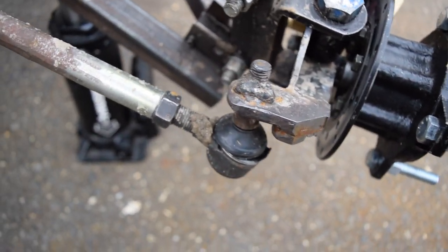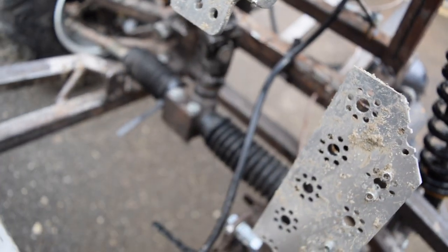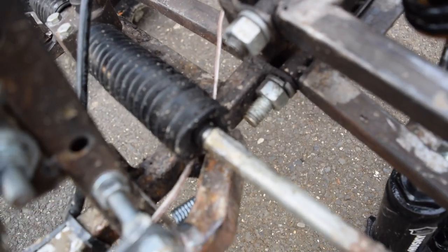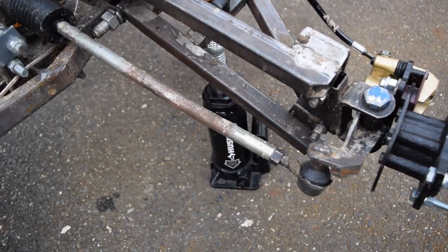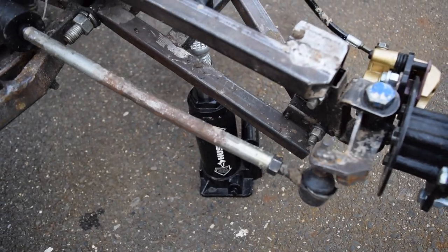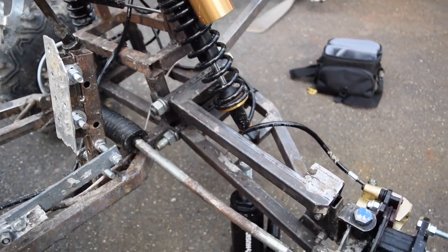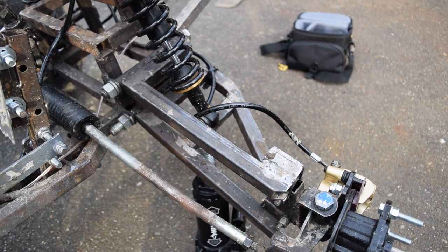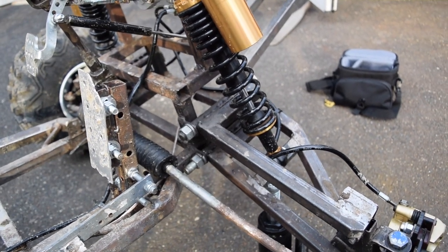The tie rod here is a standard tie rod that came with the spider box go-kart rack and pinion setup — a used one I was able to clean up. The boots have a couple cracks but that's no big deal. I had to do an extension to these because I had longer A-arms in the front, so I just cut out a piece and welded in some 5/8 inch rod. Addressing the rust issue — I've been changing things constantly, never with a set goal in mind, so I don't see a point in painting it yet. I'll just take a flap disc and get rid of the rust when it comes time to paint.